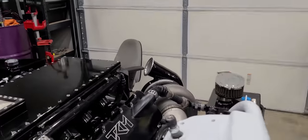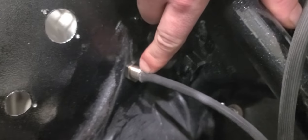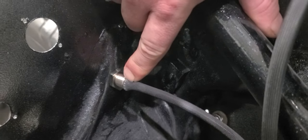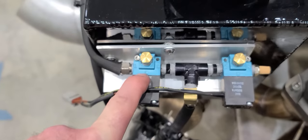The other leg of this T comes down and goes to a firewall bulkhead — this is a firewall bulkhead for the CO2 line. Disregard the other bulkhead; that's for the fire system, that's different. It comes out of that bulkhead right there and then just travels over to the solenoids.